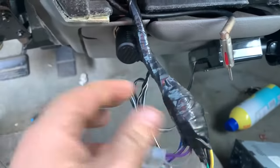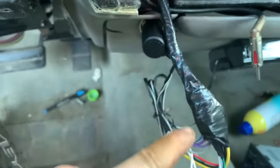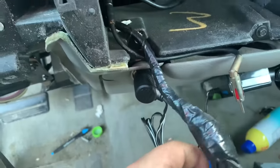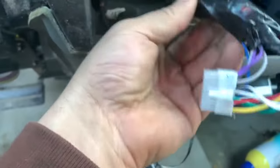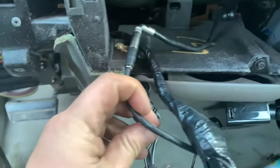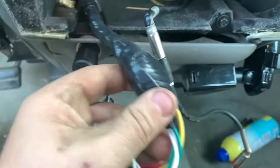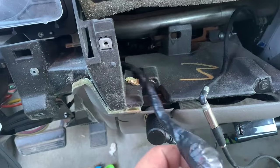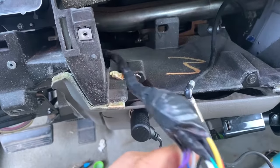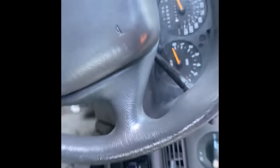This is the final result — everything's taped together. I individually taped every loose wire so in this entire loom there's not one wire touching another — it's all insulated by electrical tape. I heated it up and pushed it together and it's very solid — this thing is not going anywhere. That's pretty much all it takes to wire up a radio without a clip. It's not hard at all and for the lifetime of the car it'll always be there.